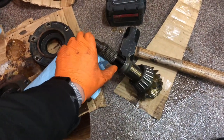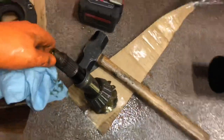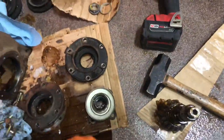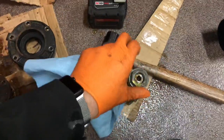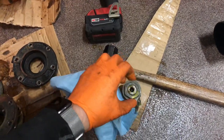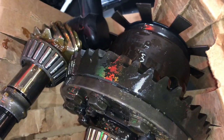And there we have her — crush sleeve, pinion gear, the bearing, and no bearing race; that is still inside of the case. So I'm going to send this guy some photos of these things, make sure that's all he needs. I don't think he needs the input shaft or anything like that. I'm guessing he's going to want this screw. In order to get this out, it doesn't just pop out — you will have to tap on it, but it doesn't take very much force, just go slow and don't nick it because it's important to have good threads on these. And that's essentially the inside of a clutch type 188 E30 LSD. Pretty neat.